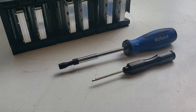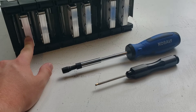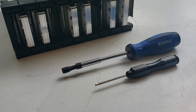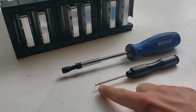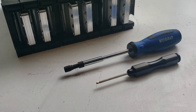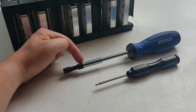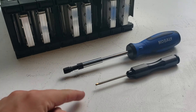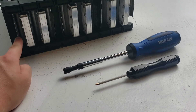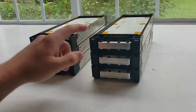A really quick tip for you guys: when you are bolting these battery plates up against the modules you start to bump against the terminals, and that's a really easy way to short out the cells. So one of the things I did is heat shrink the metal portion of your hex driver. Also you want to heat shrink your hex socket that is holding the nuts in place as far back as you can go, so that when you have your hex driver on one side and the hex socket on the other side you're not bumping up into these terminals.